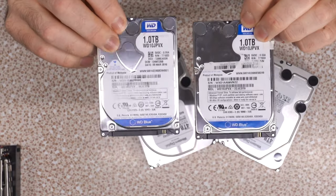So what's my plan moving forward? Well, I've invested in some more 2.5 inch drives. I have a stack of these, but none of them are big enough to do this job properly. So I recently purchased a pair of 1 terabyte Blue drives that I've actually formatted, or partitioned, I should say, with a just under 800 gigabyte partition. So there's a bit of unused space on these drives. The idea is when I fill one of these puppers up, it's ready to get burned to tape.